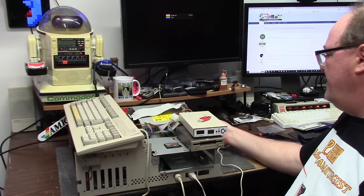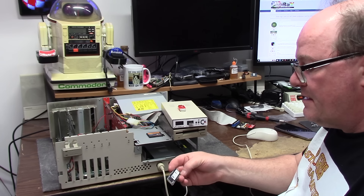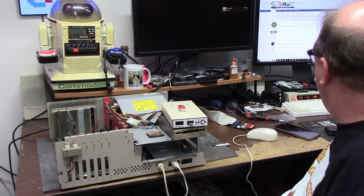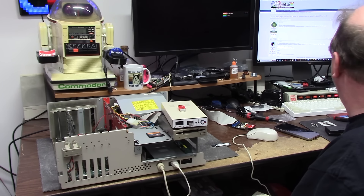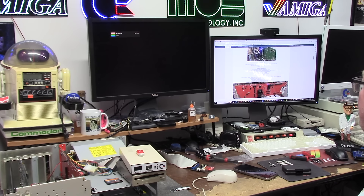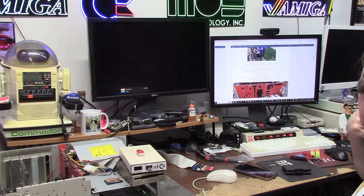But why would I do that? I paid all this money for this card — stuck in low, it will not go. So it doesn't like M-key devices. It says M.2 SATA, 6 gig per second SATA 3. It says B-key — SATA and M.2 B-key. So I don't have a B-key, I have an M-key. That's why — that's not going to work. Big shelf B-key drive — they're super cheap on eBay. We don't need a lot for Amiga. Default speed is 7 to 8 megs — you can tweak wait states to get 11 with MapROM.